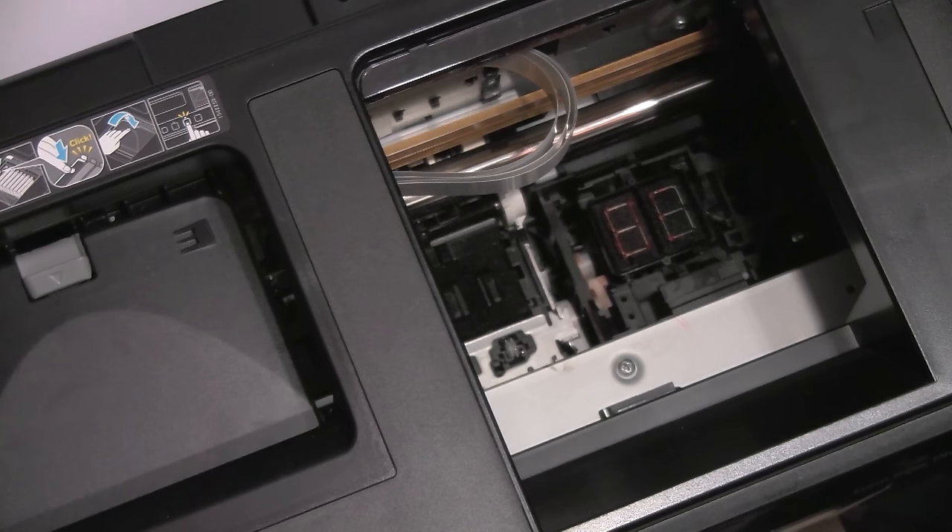Other people leave their printer on. I have left my printer on pretty much constantly without any problems whatsoever. If I do have a clog, depending on the number of lines missing — say for instance if magenta is not printing fully and it's only about 10% of the lines — I will go ahead and print a solid magenta sheet. I'll go to Photoshop, prepare a document, fill it with pure magenta, send it to the printer telling the driver not to control color, and use glossy or luster paper at the highest quality setting. That makes all of the nozzles fire and ensures magenta is being used the most.